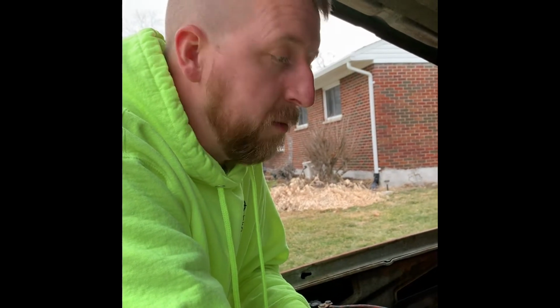So what we're probably going to want to do at some point is disconnect that fuel pump hose because there's probably 25-year-old gas in the gas tank. And then we'll probably order another tank and a new sending unit because that stuff's probably just garbage. But we'll disconnect this fuel pump hose and see if we can get it to run off the can. Probably not today, but maybe at some point. I don't know, we might try it today. And then if we can get it to continue to idle and get up to temperature, we'll start checking other things and start ordering parts as we need parts.